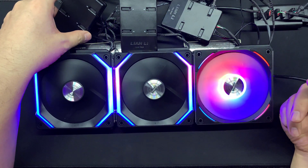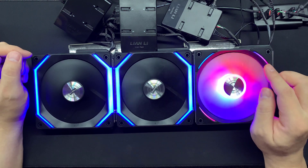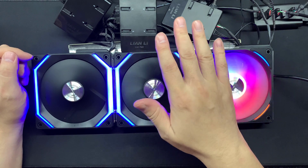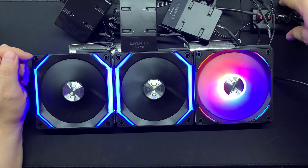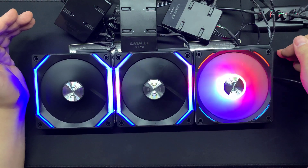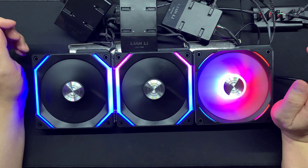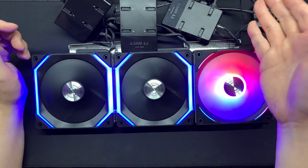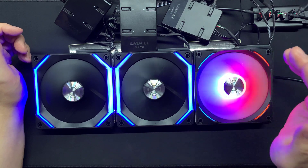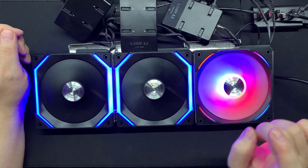I've shown you how to do the firmware on the older SL controller. I myself have done two just to illustrate that L Connect 2 can control up to four controllers. You can see three controllers here. If you want more than three controllers, I advise getting a splitter. Make sure one splitter controls two controllers - for the third and fourth, get another splitter. This way you won't overload the splitter or the controllers. One controller can take up to 16 fans, so four controllers is 64 fans. Just be mindful of thermal management in your case, as ARGB does run hot.